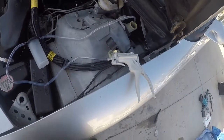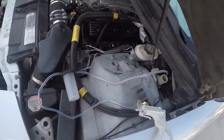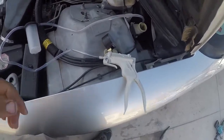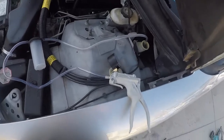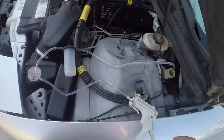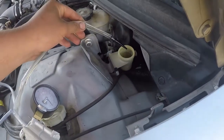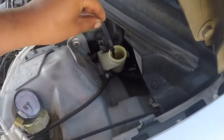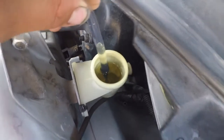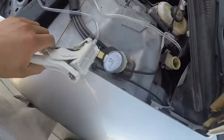This is a little video on how to bleed your clutch on a T56 - it's a 95 Trans Am. This is really the only way and the fastest, most efficient way to do it. You use a Mighty Vac, get that tip, stick it on there, and stick it inside the hole, then just start pumping.